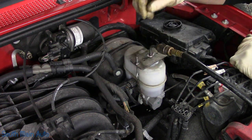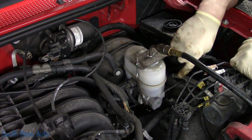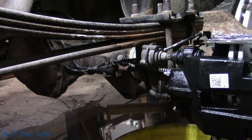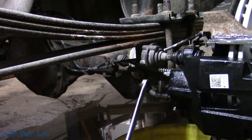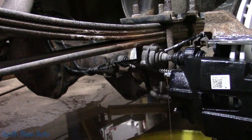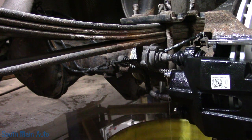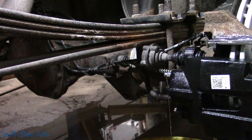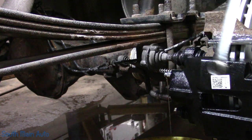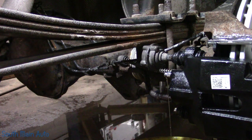I can see it's just starting to fill the reservoir. If you have an air leak it'll fill it all the way up and then squirt all over the place. Starting back here on the right rear — we'll leave that open. I'm going to go put a little bit more air pressure in the pressure pot. We're going to let her pee until she comes out clean. I've got both rears dribbling right now — about 18 pounds in the pressure can. It's still coming out pretty yellow. There's a lot of crap in the lines. Once I have fluid out of all four wheels, I'll go up there and pump the brakes, bring the pistons out on the calipers all the way around. Sometimes if there's still air trapped behind the piston, that'll loosen it up. So with the pressure pot still on, I'll crack them all loose again, make sure there's no air, and we'll call it good.